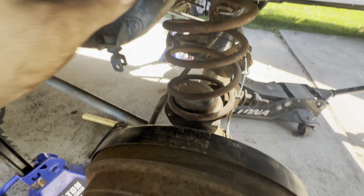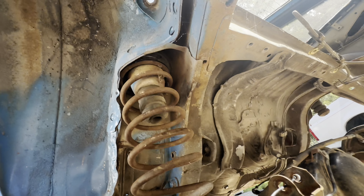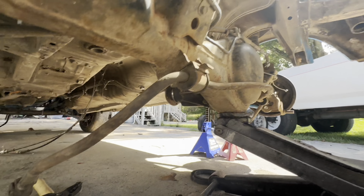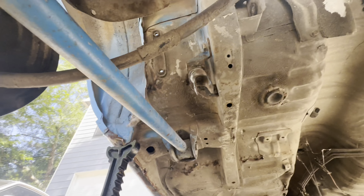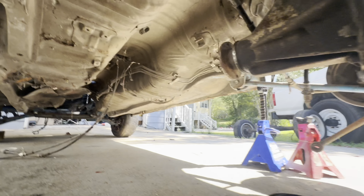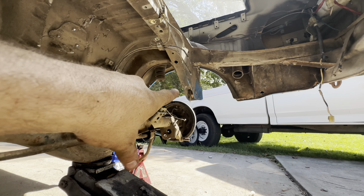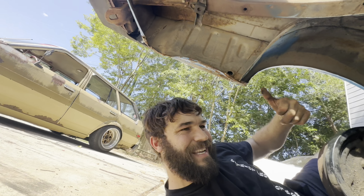We'll pick tail lines up. And up here, we didn't put the isolators in, but their little rubber isolators are still supposed to be there. And we'll just jack this up into place. Then our sway bar end links run up to these end links, already still on the chassis. And if we had the panhard bar, it would go from that cross arm down to this stud, and we would be in the money.